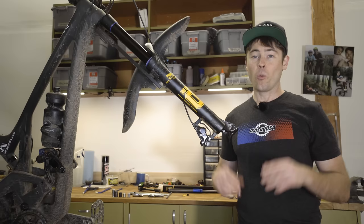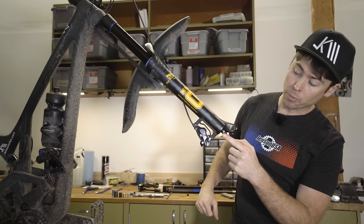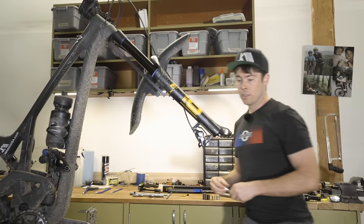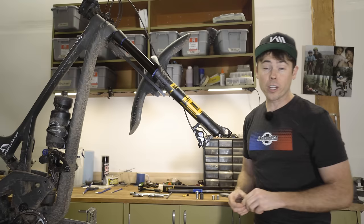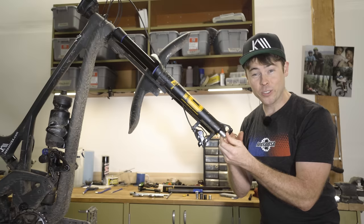In order to swap the travel of your RXF36, you're going to need a new air cartridge — I've got a link to these over at Jensen in the description below. One thing about the Ohlins fork that's a little different than the Fox and kind of cool is you don't need to pull the lowers in order to change the travel. You just unbolt the cartridge at the bottom and at the top and pull it right out, then throw in the new one. We'll try a 14mm socket to loosen this thing up — it's really tricky to find a socket that'll fit between the dropout and the actual nut.